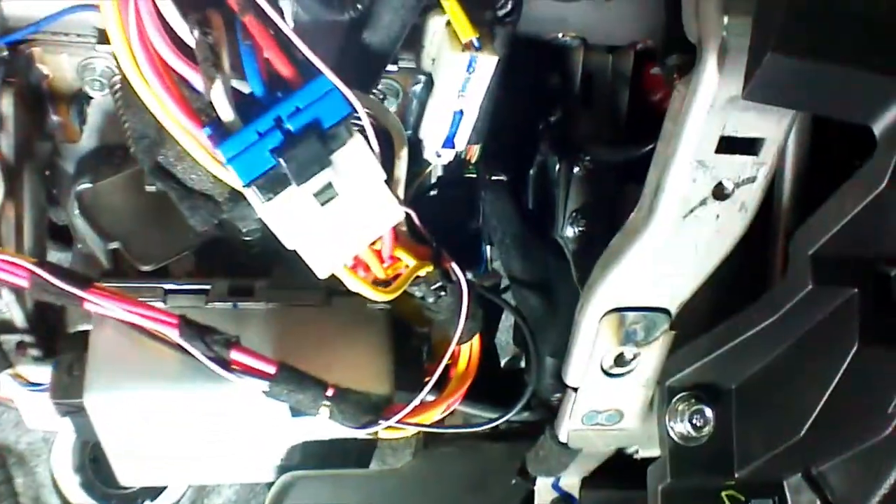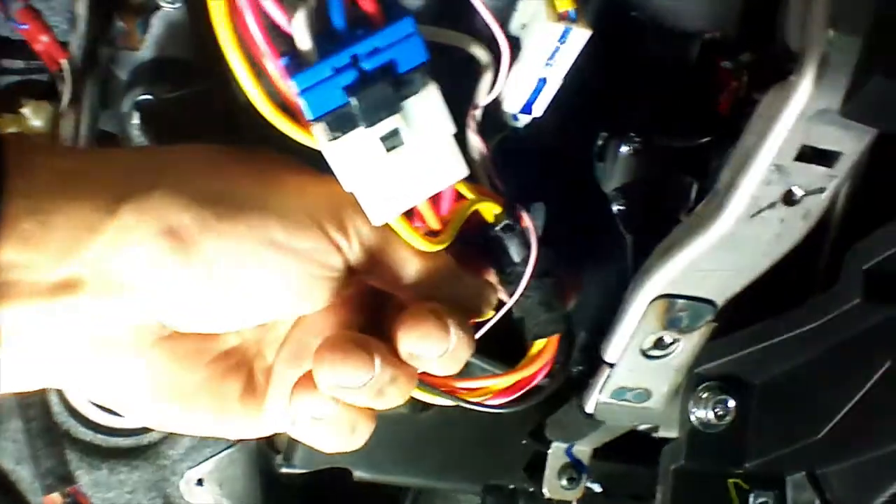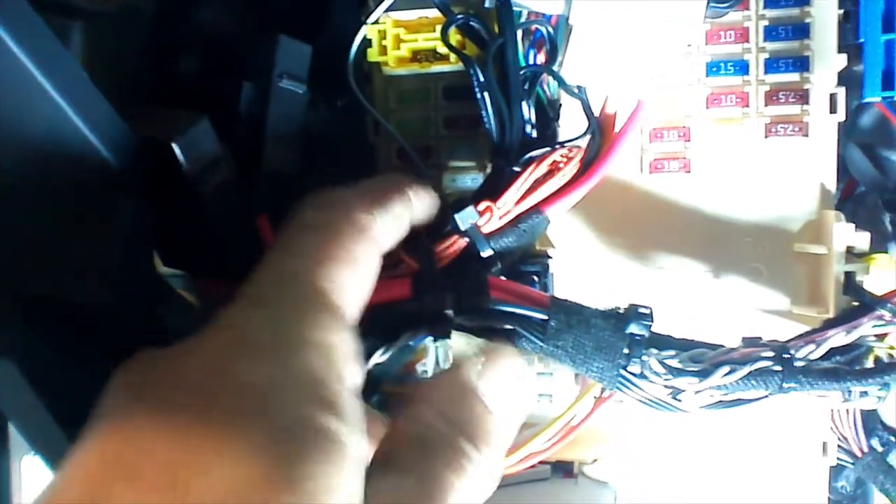Here's the end result. The ground branch goes to the 10-millimeter back there. Our wires loop back around, go up underneath the steering column cover plastic, with the parking light wire following the main harness. We come over to our zip tie through the BCM so we're not pulling on any other harnesses, and we've also done a little loop here to use up some of the extra harness length. The zip tie goes around the two posts — you can sneak it around them and this thing is rock solid. Nothing is going to rattle, nothing is going to come out. The end result has to look good too; I don't like messy installs.